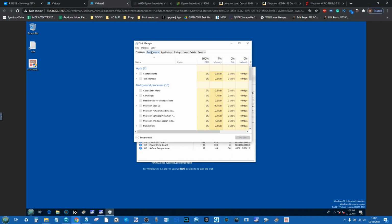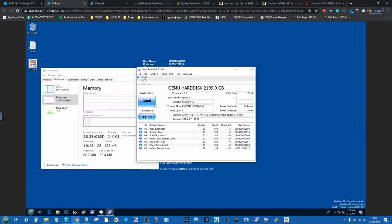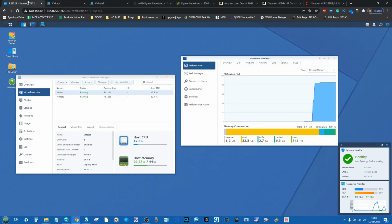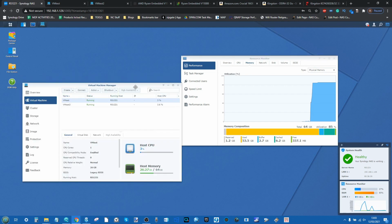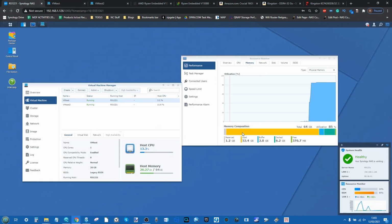As it goes in there, we will be running a follow-up video, particularly on this NAS, talking about memory utilization, all 26 gigs showing there. Although in other systems I will show off the memory, in the test we're running right now, although the VM is displaying that memory, it doesn't necessarily mean it's definitely still available. The CPU doesn't guarantee that it will be able to take advantage of all 64 gig. It may be kind of phantom memory. So on this device more than any other, I am going to be doing follow-up testing, another video, where I'm going to be using Passmark on these systems at the same time and really slamming the utilization of that memory. It's very hard to run these tests without bottlenecking the CPU on a VM on a quad core like this one. So that's a lot of the time why maximum memories and certain CPUs end up being more of a capability than anything.